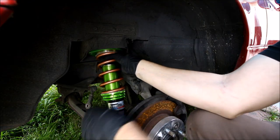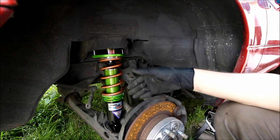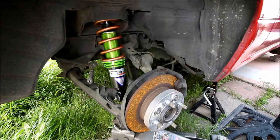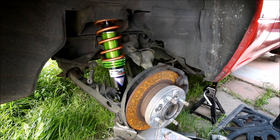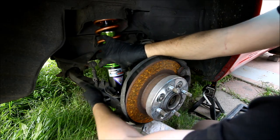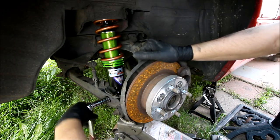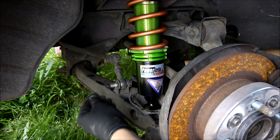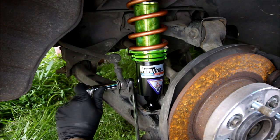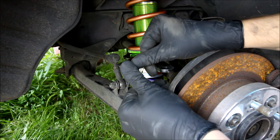Top in first. I've lowered it as much as possible to make the coilover really short. You saw how easy that was — I didn't even have to step on the brake. Now I just need to get it all bolted up. It can be a huge help to throw a jack underneath the suspension arm. This bolt right here can be a pain to get in — there we go. Just get my preload locked in.